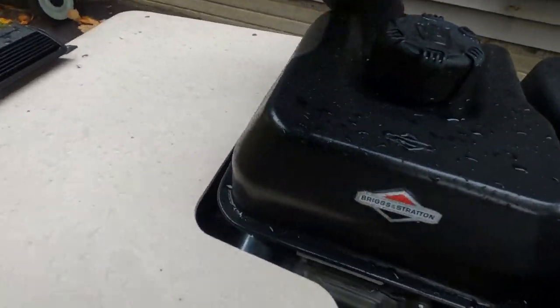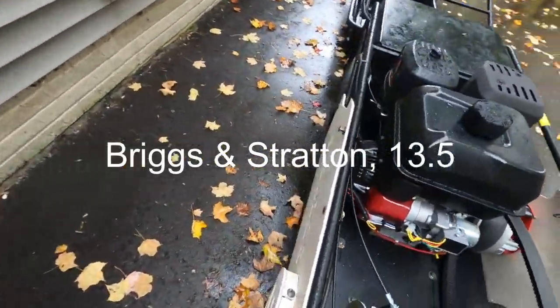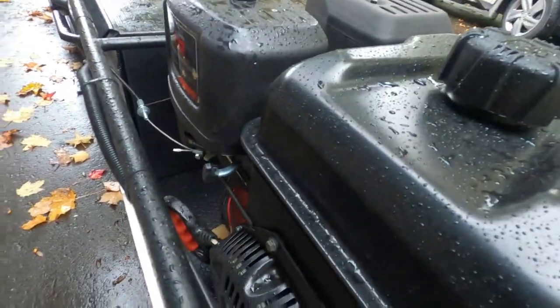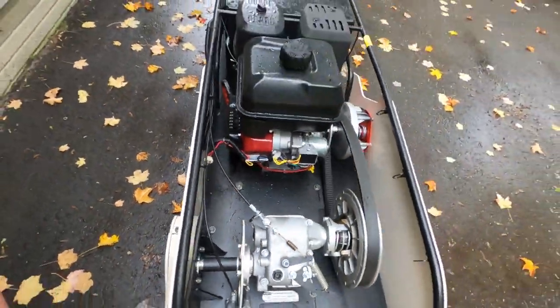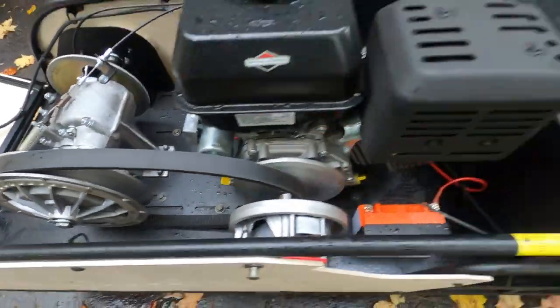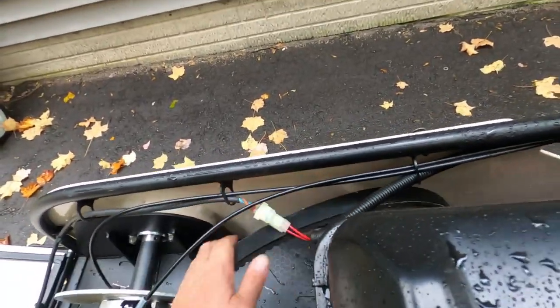Ask me how I know! Running these two little snaps here, got a hard cover for that. Running a Briggs and Stratton engine — I think it's a 13 and a half horse Briggs. There it is — got a 13 and a half, 420cc engine, XR Professional. The choke control is up there, pull start right here. Regular gas. Got a clutch for the brake right here, and it's got a parking brake as well. Just like a snowmobile drivetrain, everything is accessible right here. Beautiful new belt. We did buy a spare belt — they're like 70 bucks. Making sure that gets put in the right spot so it doesn't get lost or break something.